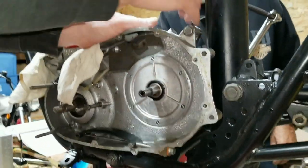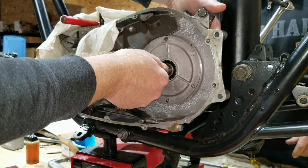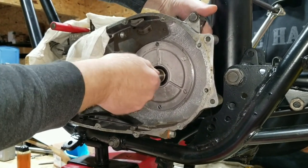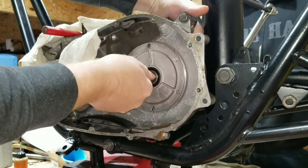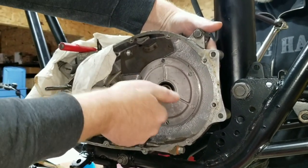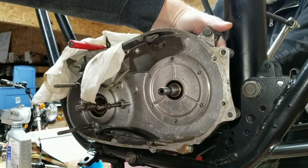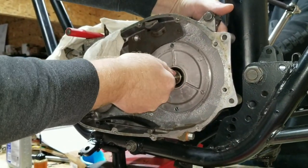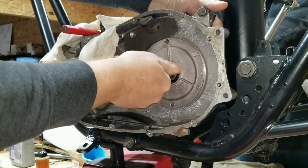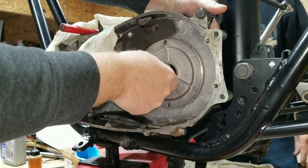We put the kickstarting gear on and installed it. We're going to have to take this back apart to seal it — if you notice, we didn't put a gasket in here; gaskets didn't happen until the 750s came out, so they used a bonding agent between the two surfaces. We'll use that 518 stuff. Right now we're putting the kicker cover on to see if we have all four gears. Going over to the sprocket side — spinning the main shaft — we're already in fourth, there's third, that's a gear, second is a gear, and right there I can hold the sprocket while spinning the main shaft. That's neutral. We've got all four gears working.